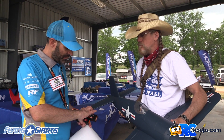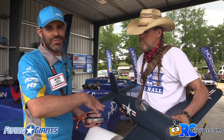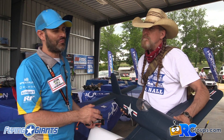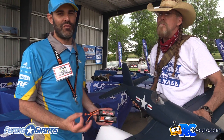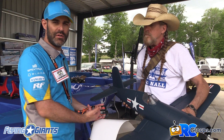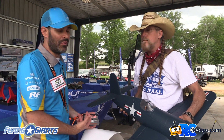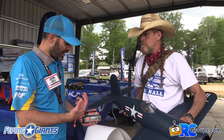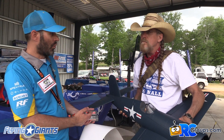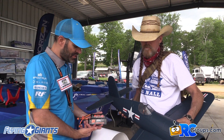When we updated the power system, we went from 3S only — some guys unofficially recommended and flew it on 4S — to now officially being set up for 4S. We've been flying it with everything from a 3S 2200 or 4S 2200, which is very popular, up to a 4S 3200. It's pulling about 70 amps now, so a 2200 will work but it's pushed, and flight times are kind of short — maybe four to five minutes at a lot of full throttle, or you could eke out six or seven minutes. I like the 3200 myself.